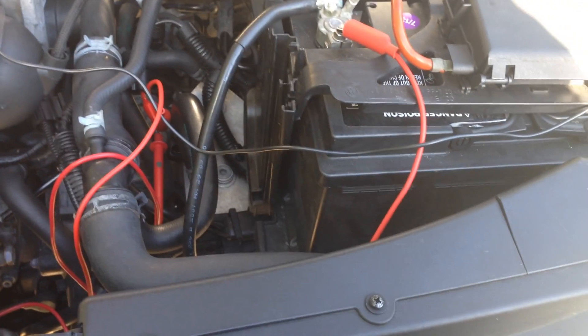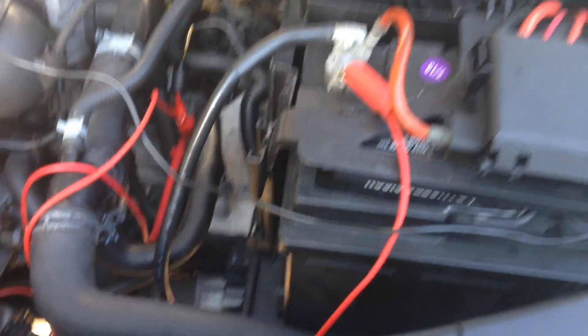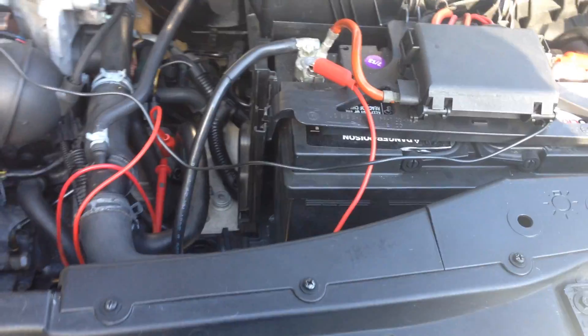So you need to load test the wire. Keep in mind this caveat: you need to know where you are in the circuit. If you're in the wrong place you can burn other stuff up — you can burn your ECM, you can melt wires. You really need to know what you're doing.